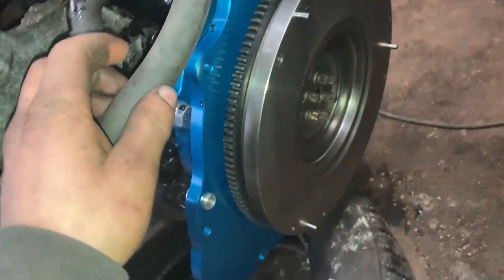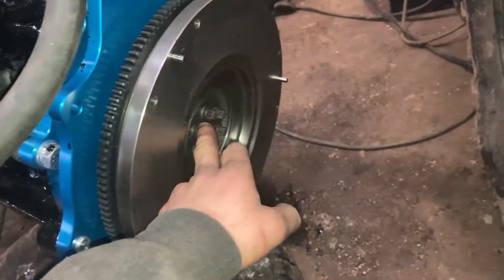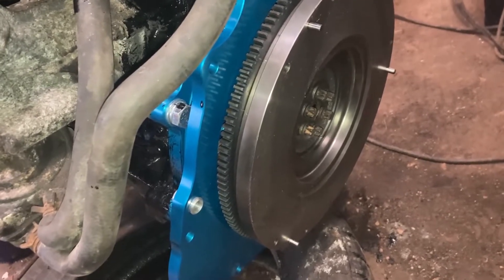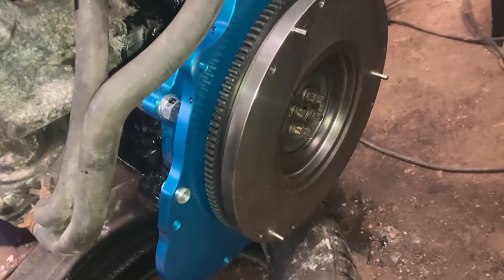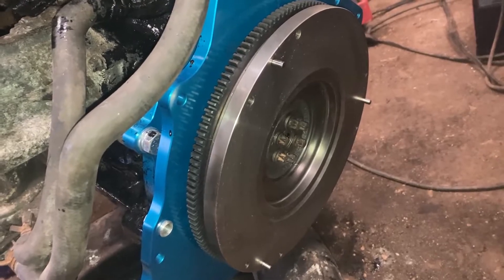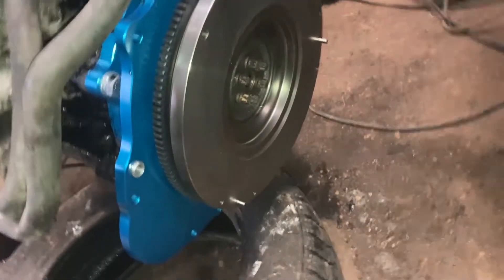The adapter kit is mounted up onto the engine and the flywheel is mounted. I had to actually shorten the bolts to fit into the flywheel adapter — or crank adapter — that the kit comes with. I just finished cleaning the flywheel off with the degreaser and I can see it's got a lot of fuzzies on it that I'll have to clean up. Then I've got the pressure plate, friction disc, and alignment tool ready to put it all together.